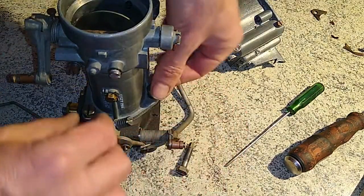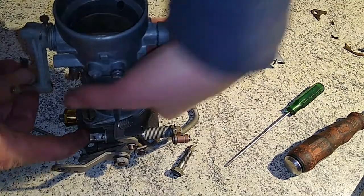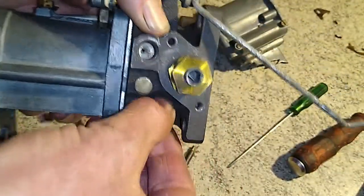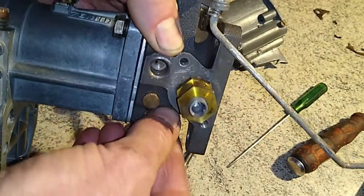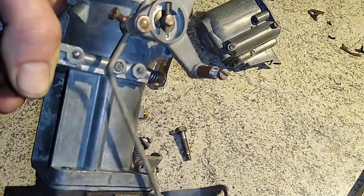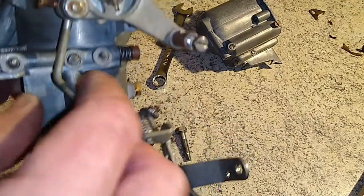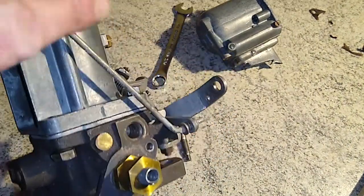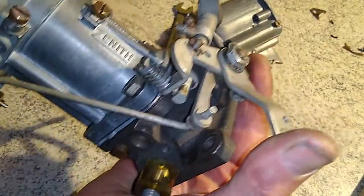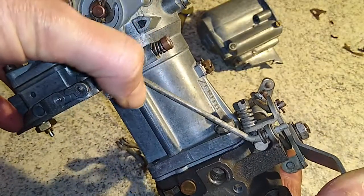This is held in place by three screw bolts: two go in from the top and the third goes in from the underside. If they have spring washers on them, leave the spring washers on because they can rattle apart with vibration. Just remember when you drop this back onto the base to route the choke cable in if it's still attached, because you can't get to it easily after. This guy here is a link up to the choke plate from your throttle, so when you're at idle and you give it full choke, it pulls on that cable and lifts the idle up a bit as well.